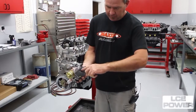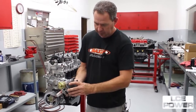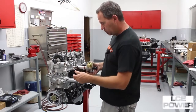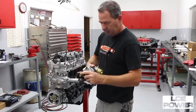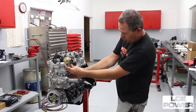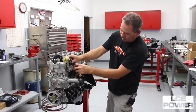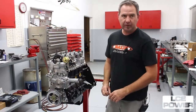We're getting ready to set our distributor in. Where the number one is marked on the cap, we make a mark on the housing so we can take the cap off and still know where that mark is. Set it to top dead center — number one cylinder is at top dead center on the power stroke; you can tell because both valves are closed. Assembly lube on the O-ring, on the gear, and on the end of the shaft. Make sure the rotor lines up and we still have enough adjustment to time our distributor. That'll be close enough to get a start until we get a timing light on it.